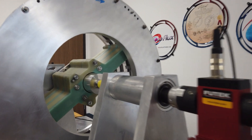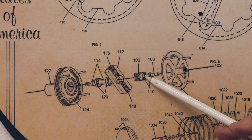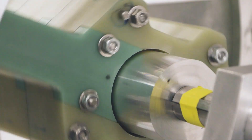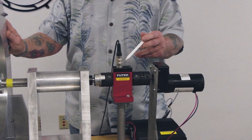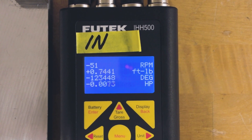It takes a very small amount of power to turn the radial director. The radial director needs to be activated mechanically or by an electric motor outside. In an electric vehicle, this would be hooked to your accelerator. And it's coupled to a torque sensor here, which tells us how much torque we are putting into the motor.